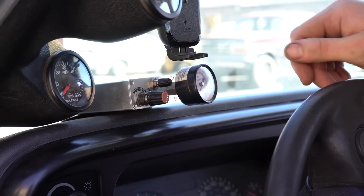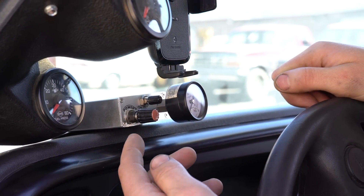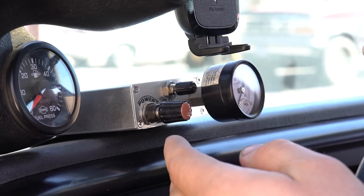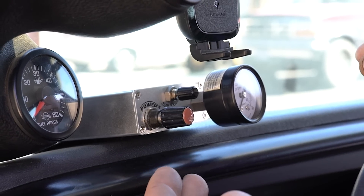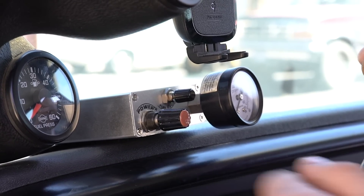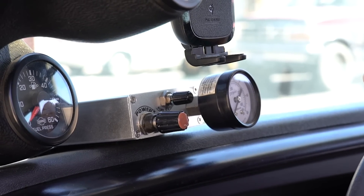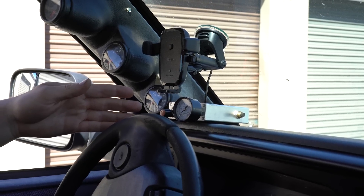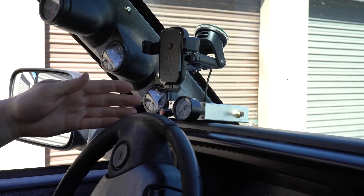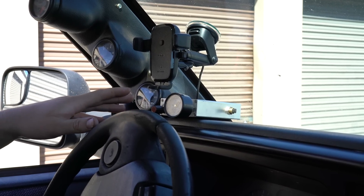Now let's take a look at the in-cab portion of AFC Live. I have my AFC Live mounted to the top of my dash. On this side you can see the knob labeled Power — this controls the total amount of air pressure available to the AFC and sets your power level. Think of this essentially as an infinitely adjustable fuel plate. The smaller black knob controls the fuel rate, allowing you to adjust how fast the boost signal comes in. Don't be confused by the gauge — it's not a boost gauge; it's showing you the modulated AFC reference signal after it's passed all the other valving in the controller.